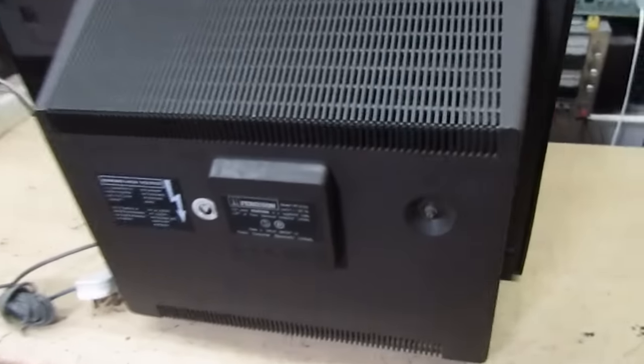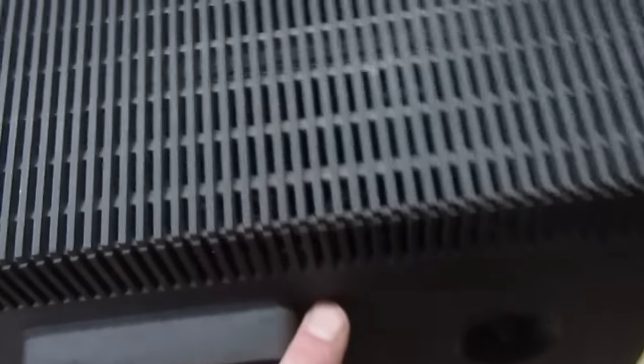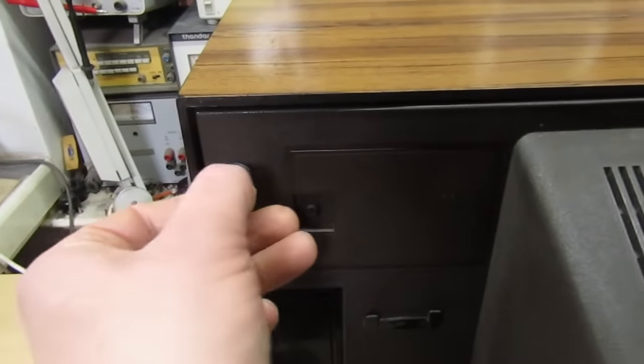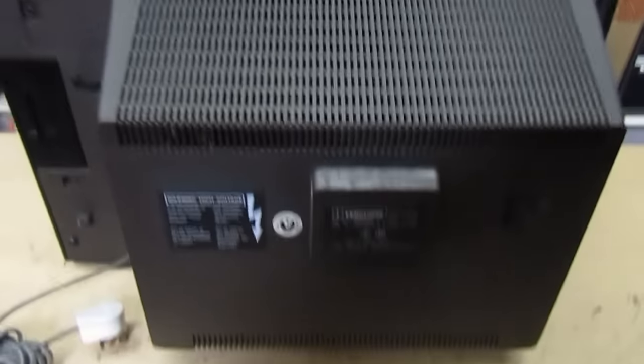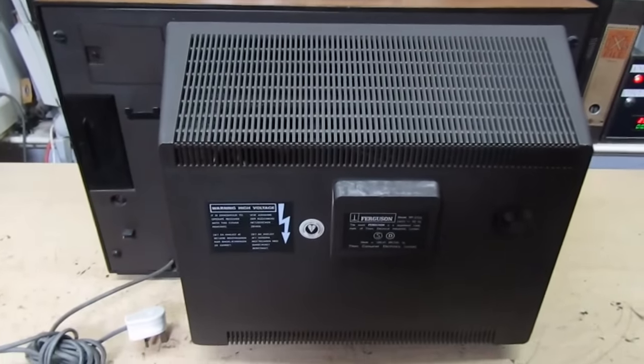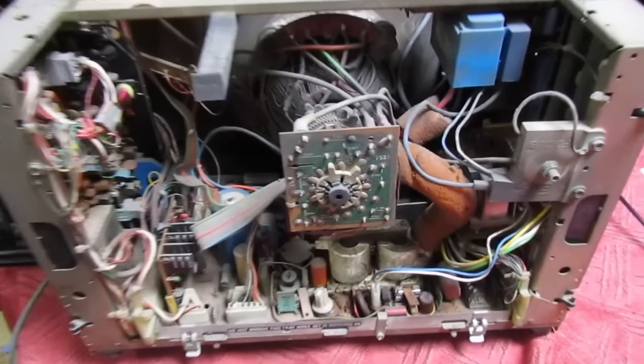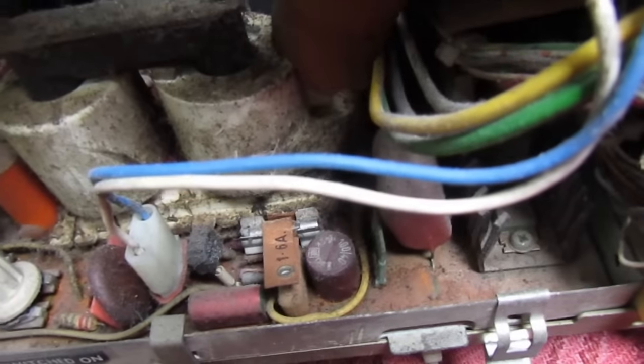That's the back of the telly - it's actually in very good cosmetic condition. There's the focus control. Years ago when I used to sell reconditioned TVs I'd wash all these grooves in the sink with a paint brush to make them look nice. The model number is 3722, made in Great Britain by Thorn Consumer Electronics Limited. Just four fastenings to get the back off - unlike some plasma TVs where you've got about 50 screws. So that's the back off; it's actually a lot dirtier inside than it is on the outside.